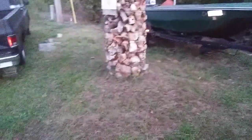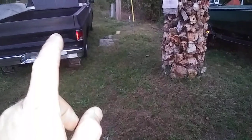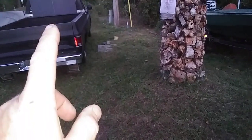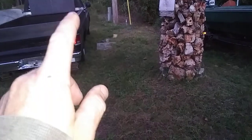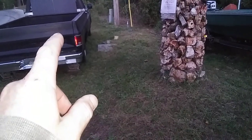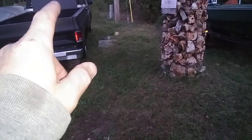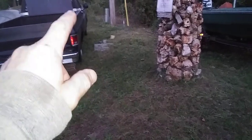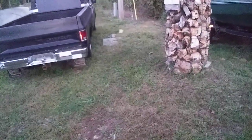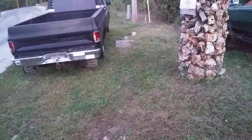I just finished doing some weed eating — all this was growing up pretty heavy around the truck. At some point we're going to get this thing running. It needs an oil pump, new oil pump shaft, intake gasket set, and new upper and lower radiator hoses. Other than that, the cranking-over-not-wanting-to-fire situation's been fixed — I got the switch on the steering column, all the wires at the bulkhead, the distributor, ignition coil, all that stuff replaced and tested.